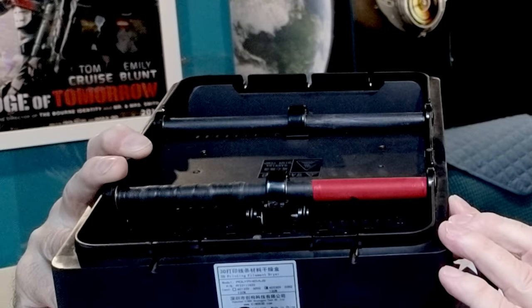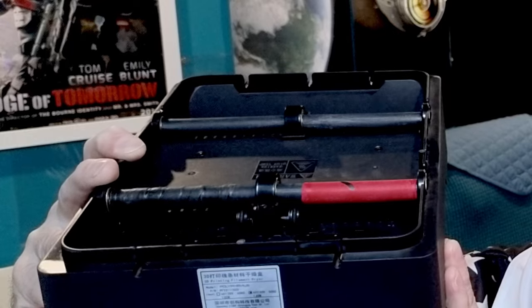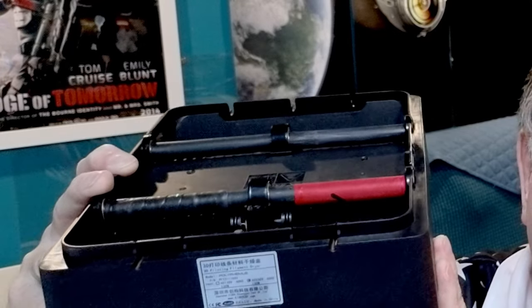And yet when we turn the rotation function on, you'll see they are turning. And you can see it's like a jerky movement. And the reason being, that is the method Eibos have used to drive them. So I'll just show you the drive mechanism close up. I can show you on here, but you'll see it better close up in a minute. But you'll see just under here, these two drive wheels, one under each roller, are on like an eccentric cam. So I'll show you that in detail now.